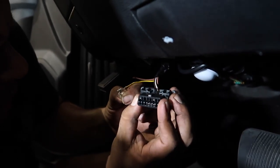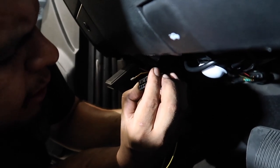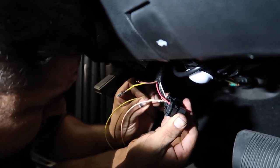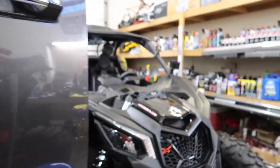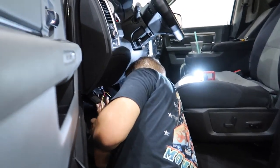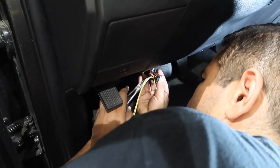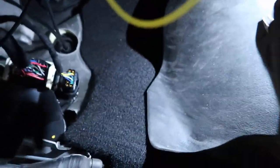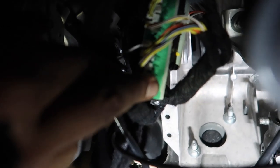We put in the 14 the same way. One good thing is when you get this kit, everything is color coded to OEM — same color code. I'll come around and show you guys where he's going to plug the other part under the dash near the brake cable. They're calling it a 'green star connection.' You're going to go to the one closest to the OBD2. This green connector right here, straight up and down, is what they're calling the green star connector.